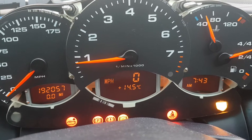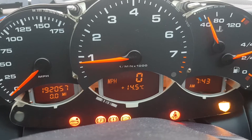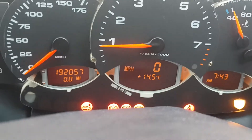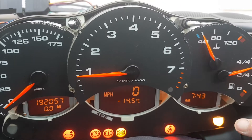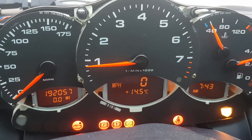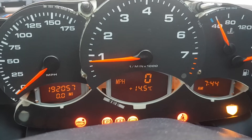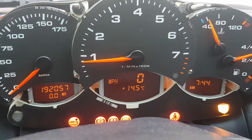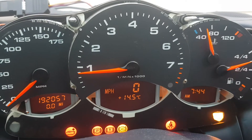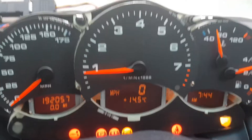As you can see, as it's warming up, the oil temperature is somewhat lower than the coolant temperature. The light has now gone on solid to indicate we're actually viewing oil temperature, showing just below 50 degrees C at the moment. When viewing coolant temperature whilst the oil temperature is below 80 degrees C, this light remains flashing to warn me that the oil temperature is low.